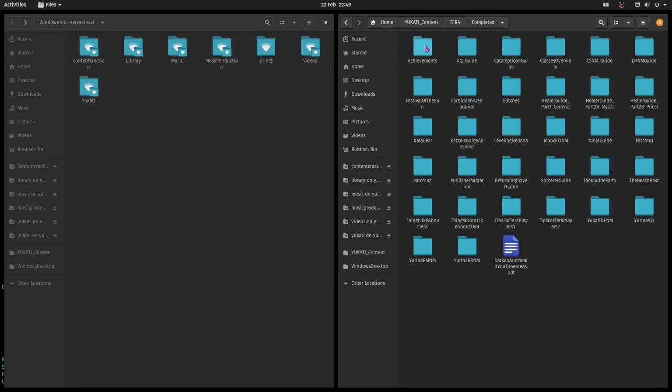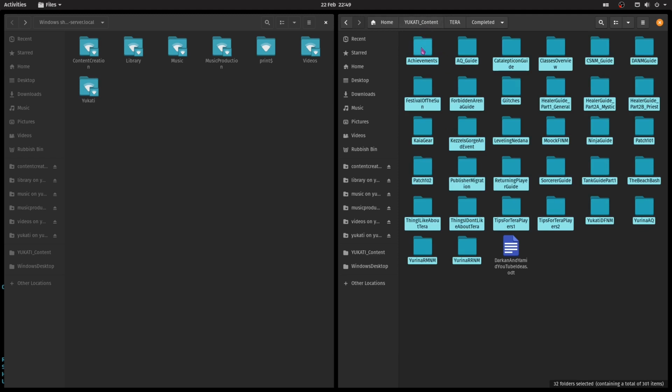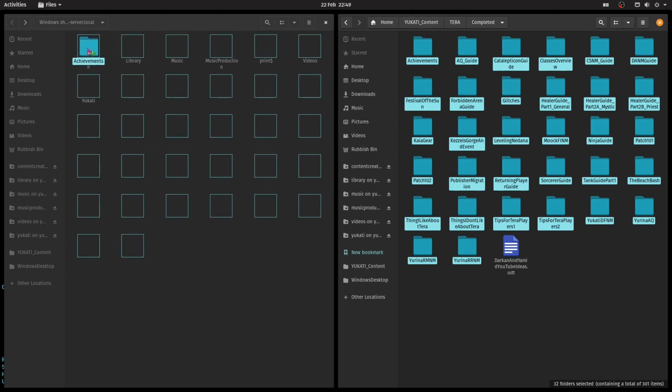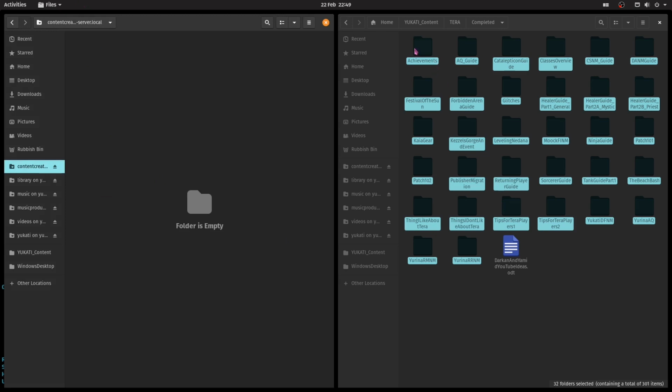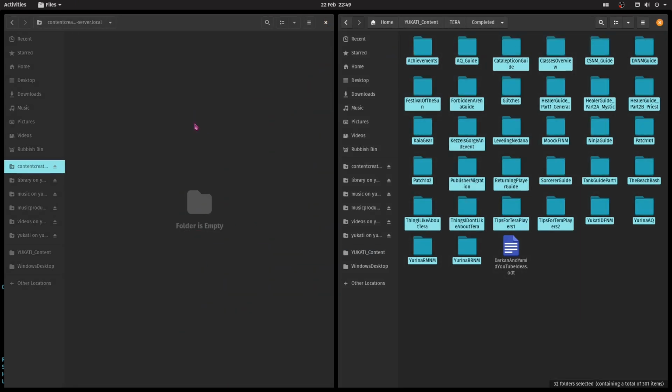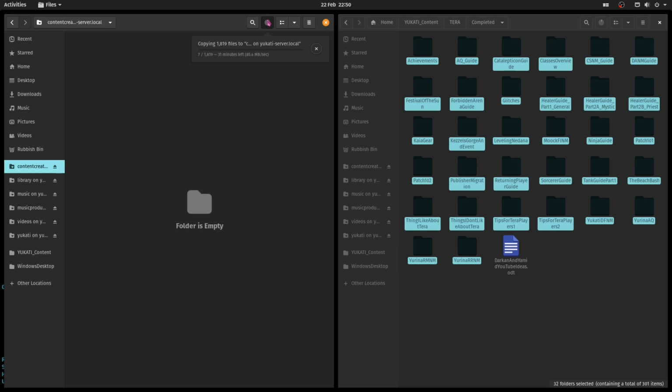Now that everything is set up, let's test the server by transferring some files over. Transferring files works, but it's quite slow. The maximum write speed during the first test was only 85 megabytes per second. There are 6 disks in this RAID Z2 pool, so I was expecting to saturate the Gigabit LAN at 125 megabytes per second. I mean, the data is split into pieces and written to 4 disks simultaneously, so 125 megabytes per second should be possible, even with the 2.5-inch drive in the mix.